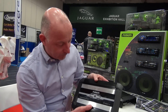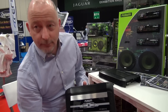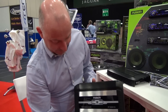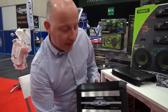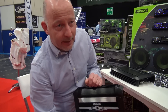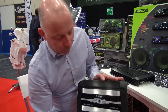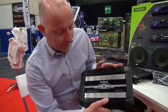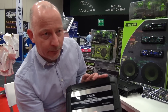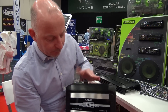Last thing I wanted to show you: the performance amplifiers. We have five types of amplifiers — a two-channel and a four-channel. The performance amplifiers: we have five new amplifiers, two class AB amplifiers — a two-channel and a four-channel — and then three class D amplifiers, two monoblocks: a 400-watt and an 800-watt class D amplifier. We will also introduce a three-channel amplifier: two times 90 watts on the front channels and one times 400 watts on the sub-channel, made class D to keep the amplifier compact.